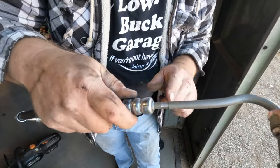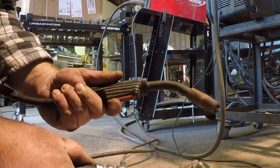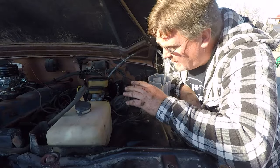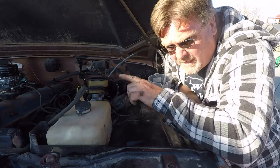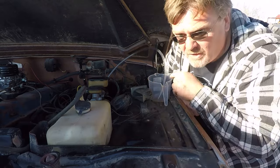Molten metal is always fun. I just ran out of gas for my TIG, so we're going to find out if you can MIG thin tubing. It's not pretty, but let's see how it works. I've got the pump hooked directly to the Hydro Boost with clear return lines. I'm not pressurizing the power steering pump first — I want to flush it. I expect a lot of fluid will return to the tank, and a little might come out of that bleed line every time the brakes are used. I'm not sure how much fluid it's going to be. Hopefully I don't overflow the reservoir too fast.